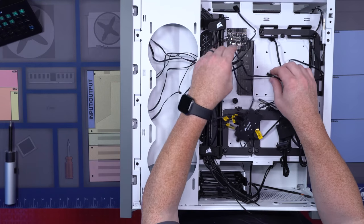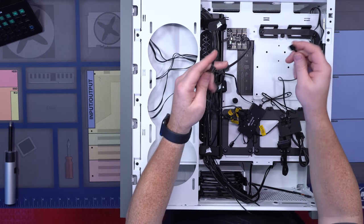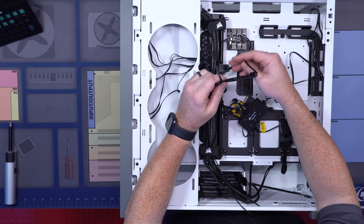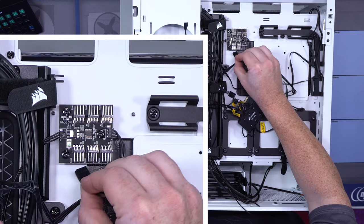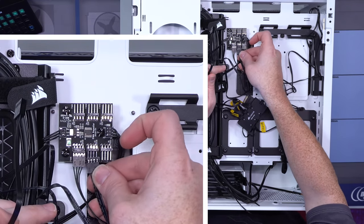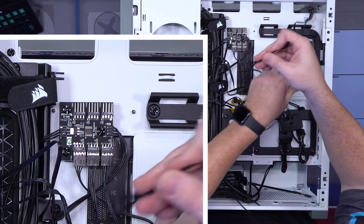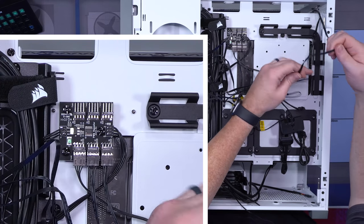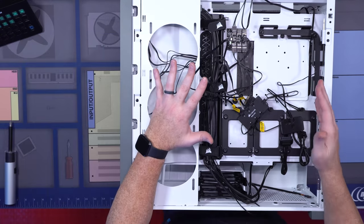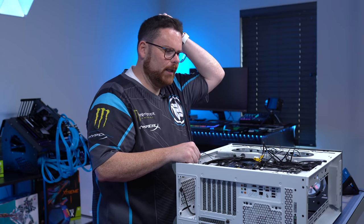Finally, let's take these fans that you have right here, and you have a fan hub for controlling these. Same thing, grab all of our fans, and you're gonna start from the left and go over. So here's fan one, fan two, fan three, and then finally up here we'll plug in fan four. Now you've got everything connected and we're ready to go ahead and put in our AIO, but we have everything set up. We'll worry about cable managing it later.